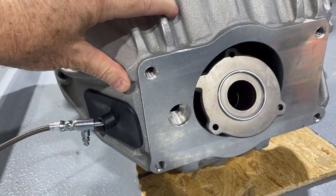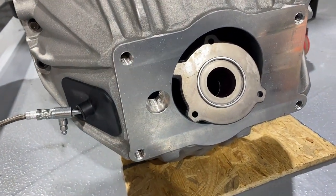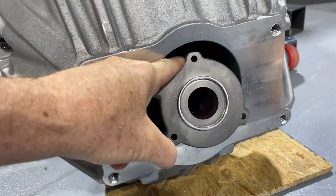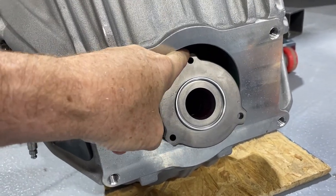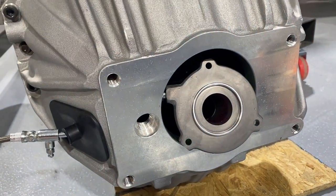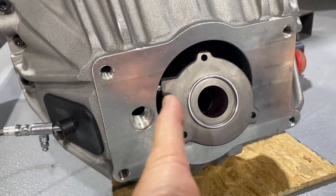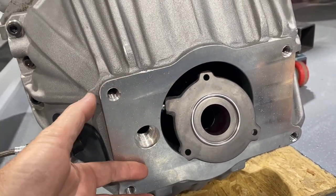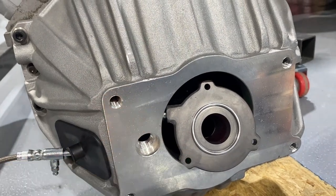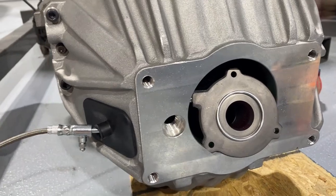So you really have to put the throw-out bearing in place like this first. Mount this up, put it in the truck, and once it's in place and we start to insert the transmission, the input shaft will go through the main hole. The guide pin will go through this hole on the throw-out bearing, which will keep it in alignment. It's just a matter of then inserting the transmission — giving us room to twist it if we have to — and the throw-out bearing is going to be in the correct place automatically. Then we can use the four bolts and mount the transmission at that point.